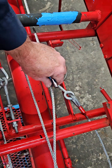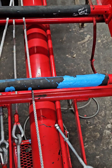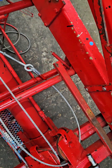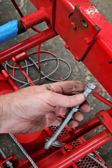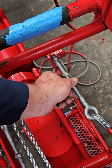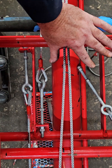Big thing to note when you're putting the new cables in: be sure that you do not get these two cables crossed, because it'll lead to uneven tensioning. When you go to put your new cables in, you'll remove the nut — so you've got two nuts here. This is your tensioner nut, and these are jam nuts. They will slide through here. Also note, your extension and your retraction cables are all the same length, so that sometimes will confuse people.